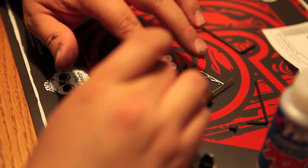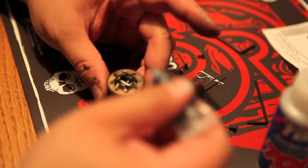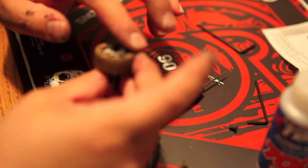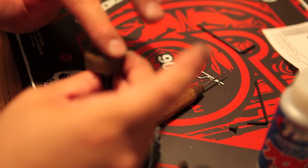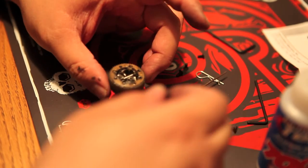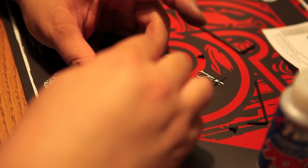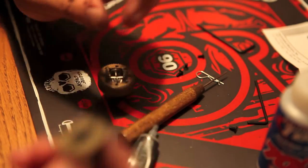You just have to be a little patient when lining that up. I'm going to put some black grease right on the area — since I don't have much control from the bottle, I smear it on my hand and then onto the cardboard o-ring. Alright, putting in the top half, which already has the sun gear and o-rings set up on it.